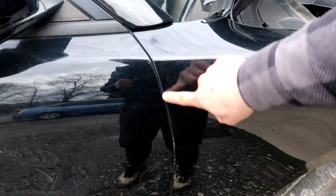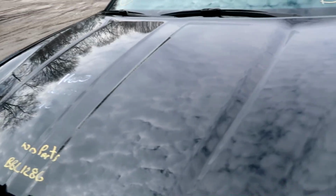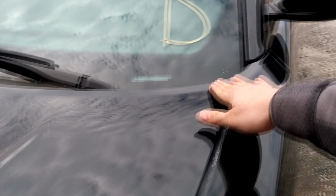The customer already threw the parts on. I mean, the gaps don't align perfectly, of course, because the frame is off, so I will have to align the gaps. As you guys see right here, this hood is overlapping the fender, and over there the gap is, I guess, a little too big. So the hood will have to be readjusted.